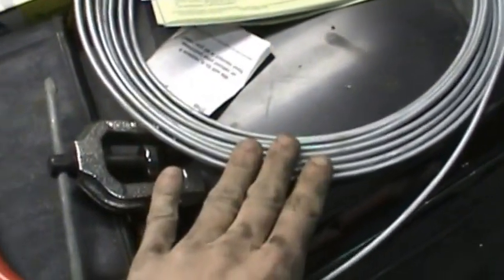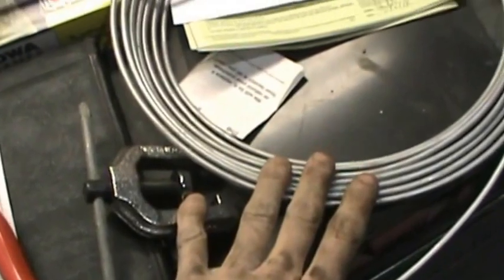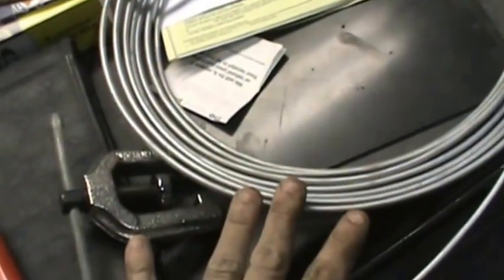Back to the point. I got that segment of line — everything from there back to where it busts out of the loom that carries the fuel lines and the rear lights and all the important stuff strapped to the frame rail. There's room in the clips. I'm abandoning the brake line because it's not going to come out of the little rubber holster it's in. We're going to run new brake line — we're actually going to use a spool. If you're building a hot rod or a restoration, you're not going to use a spool line, it's just not clean. But this has to be functional and safe. I'm going to do a professional, clean, correct job installing it.